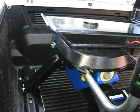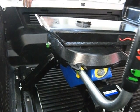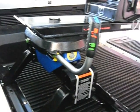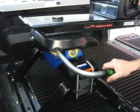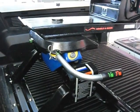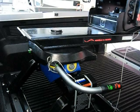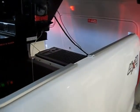And there it is. The little button there provides you with the knowledge that it's locked on. Now I'll lock the hitch in — I'll pull the handle down like this and that locks it in. I have an R-clip to go in the hole. I hook on the breakaway cable into this position here, retract my legs, and we'll pause it there and then I'll show you how it actually works.